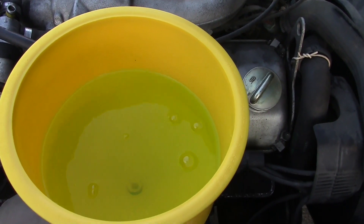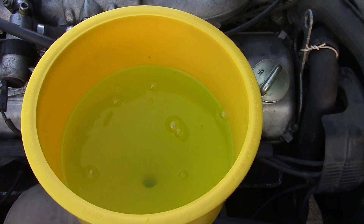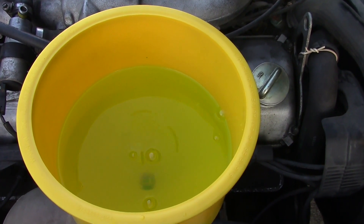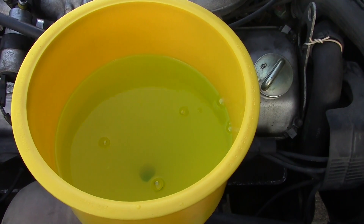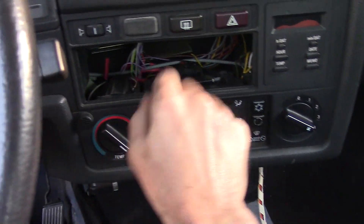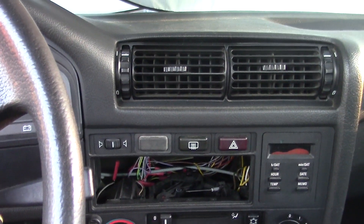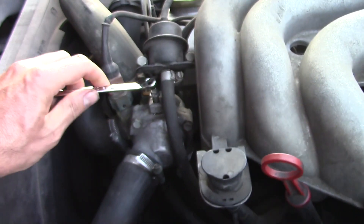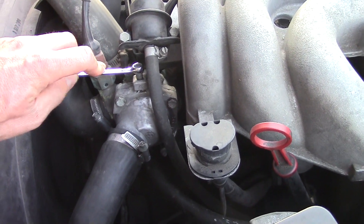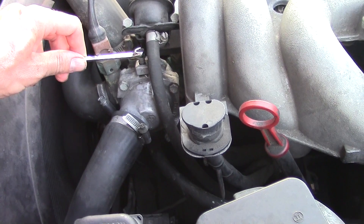Continually check the temperature gauge. Go check your coolant level in the funnel and see if you're still releasing air within the system. You'll also need to bleed the air that could be trapped in your heater core, so turn your cabin temperature dial to max heat and for good measure turn the cabin air on. You don't need to turn the cabin air on, but I use this to determine how hot the air is coming out of the vents and that hot coolant is making its way through the system. At this point you're just going to continue to bleed any potential air trapped in the thermostat housing by opening and closing the bleeder screw.